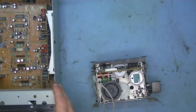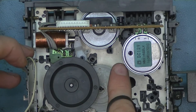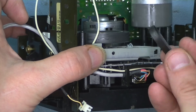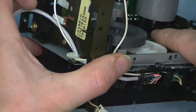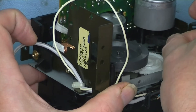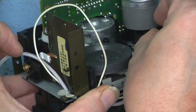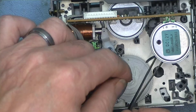Okay, so basically all you've got to do is put the belt around the capstan here and the spindle under the motor. Hopefully you can just see the spindle there. What I tend to do is squeeze the belt underneath — you may not see it for a minute as my hand goes in — but you're basically going to loop it, push it to the back of that spindle, then lift it up and hook it. Just push it in and hook it like that. Now it's hooked on that motor spindle.